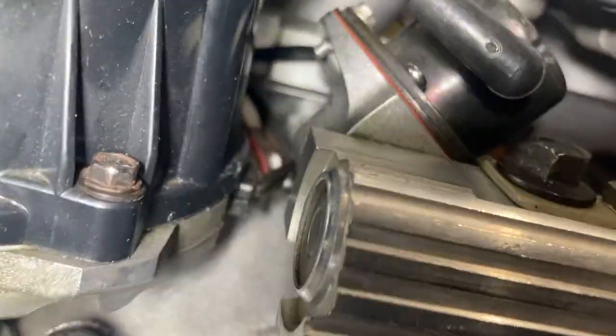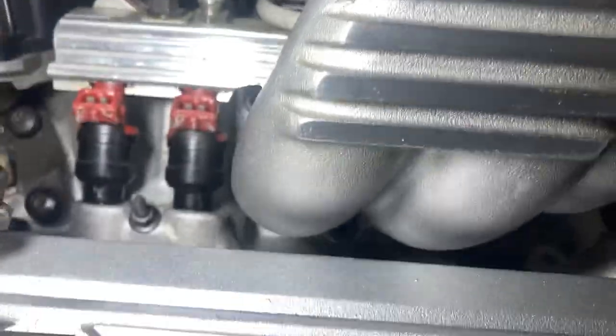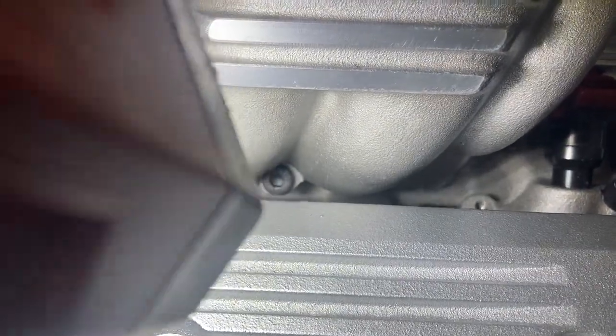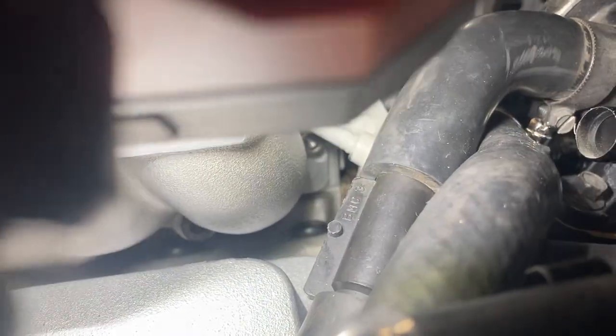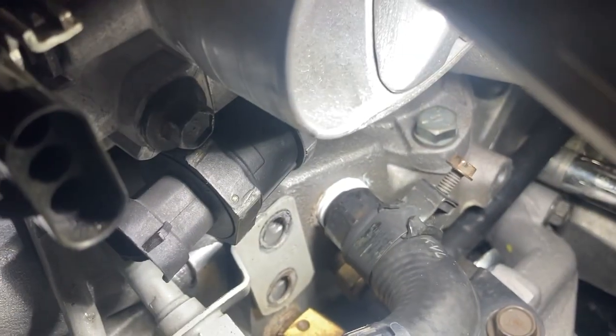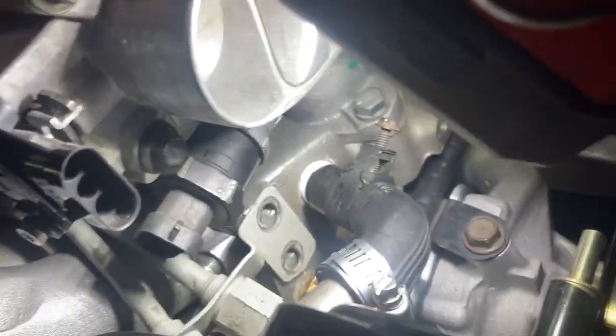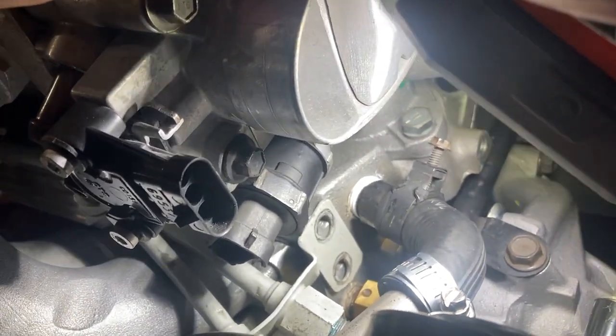On the driver's side the hard bolt is right in front of the distributor, way down in there — you can just see the tip of the hex bolt. You get to it by coming over from the other side, coming in from the back. You can barely even see it; it's right behind that black wire. You have to shove a six millimeter quarter-drive flex-head swivel socket back in there to get it. It's a lot of work. The trick before you ever tighten that up: make sure you do not have the fuel line bolts up front installed, or you won't get to it.